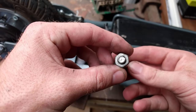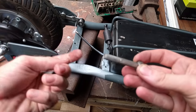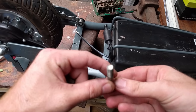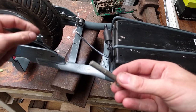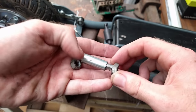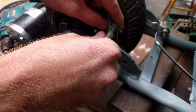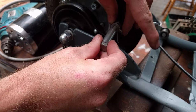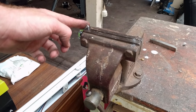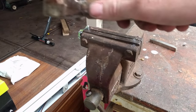To complete the brake line relocation, our friendly neighborhood machinist has made us this special bolt, which allows us to skew the brake line out one way. It's been ground down either side to have a flat on it so that it fits into the slot on the brake lever. It has a spacer and a hole ever so delicately drilled through it for the brake line, and it should do rather nicely. The ground flat edges line up with the flats on the bracket itself, and it all assembles rather tidily. We're just going to hammer over this nodule on the first bracket so that under braking, this bracket doesn't rotate — it should lock into the frame nicely.